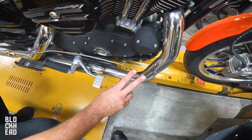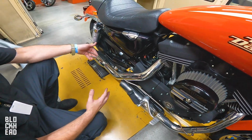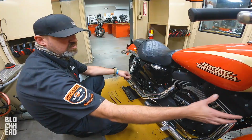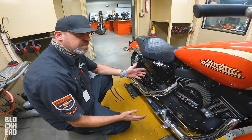We have some of these things here coming down the side. Now these are sample tubes just to make it easy for our students to get on and off the dyno fast, because I'll have a team come in here of 2, and they'll get on this bike. One will measure one cylinder and the other one will measure the other cylinder. We treat it like 2 different engines, because in reality it is 2 different engines.